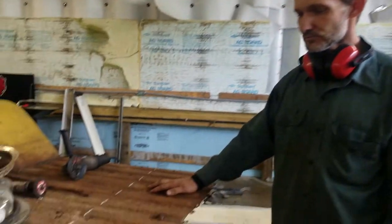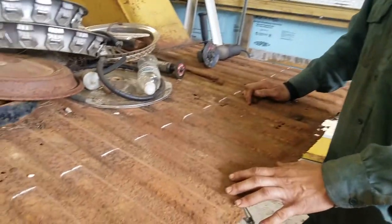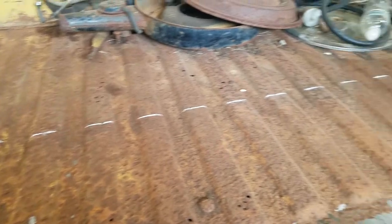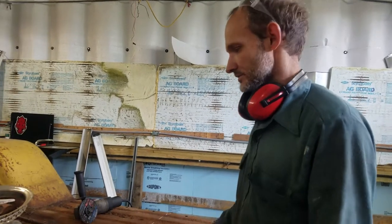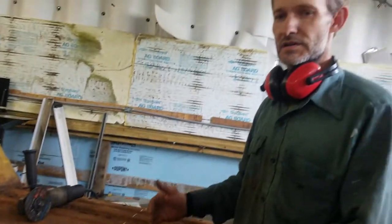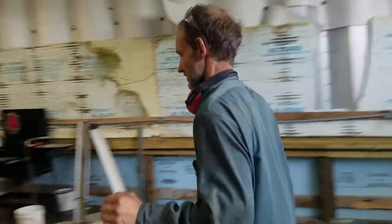As you can see, the front half of this bed is in pretty bad shape, so by cutting the front off to make it into a short bed I'm getting rid of a lot of rust that I didn't need anyway. We're going to cut the front off and go to the back — I've got an 8-inch section back there marked off. We'll walk around here and I'll show you how I've got it marked off.